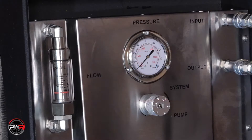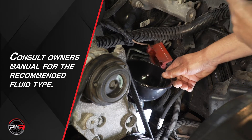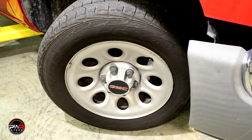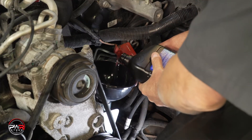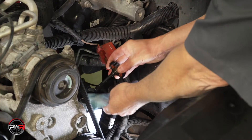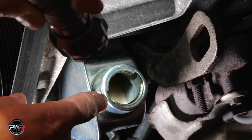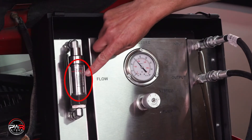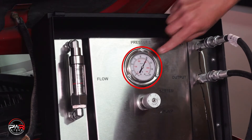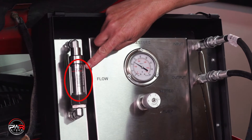To demonstrate this, we've connected into the pressure line with a flow meter and a pressure gauge. Now we're going to fill up our replacement pump with the recommended fluid type. Before starting the engine, turn the wheel lock to lock 10 times, then refill the reservoir if needed. Start the engine and turn the wheels again lock to lock 10 times, checking the reservoir one last time and checking the system for leaks. Here you can see the bubbles in the new fluid — this is the air we need to remove. We can see from the flow meter that we have proper flow in the system and from the pressure meter that the pressure is normal. We have moved the wheels in one direction to lock and can see that the bypass valve is working properly in the pump.